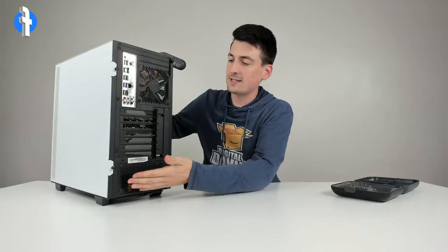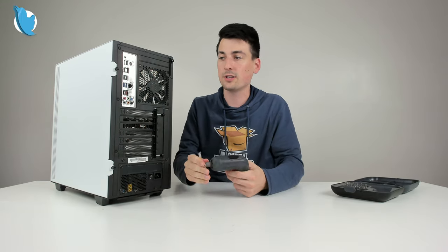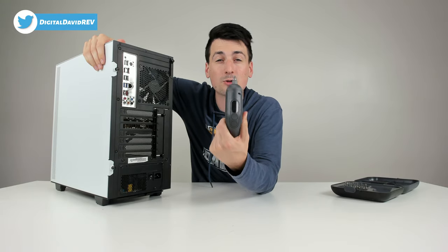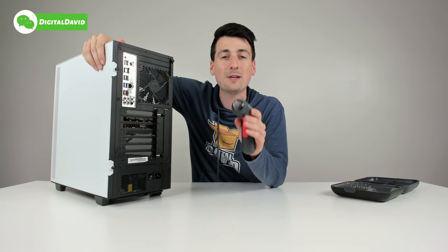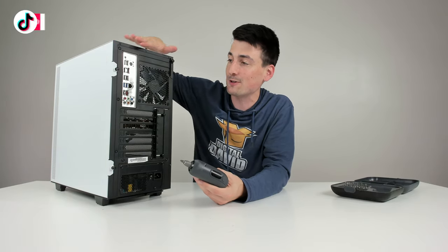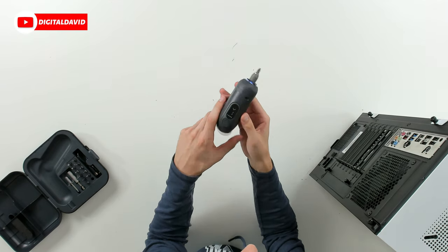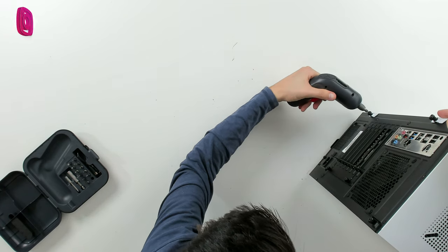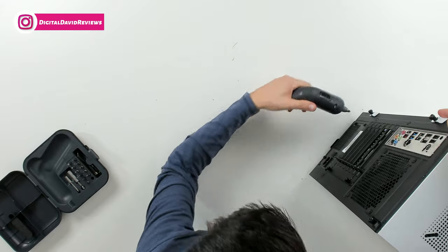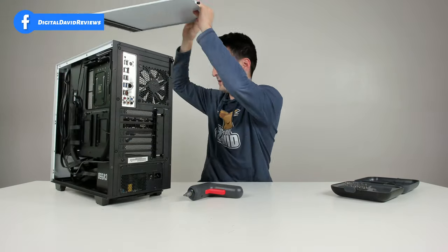We've got a desktop computer right here and we're going to remove the panels and prep the graphics card slot using the cordless screwdriver. Make sure you have the correct torque settings — I highly recommend using a lower power and increasing as necessary, but be careful not to strip any screws, especially for sensitive electronics. In this case, we have it set to one, our minimum torque setting, with reverse selected since we're driving these screws out of the case. We're just going to line it up and gently loosen everything, and we should be able to get the panel off.